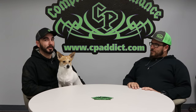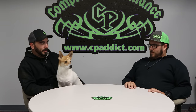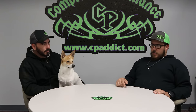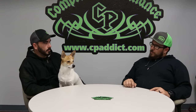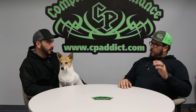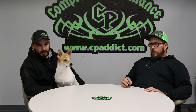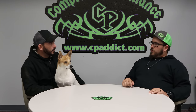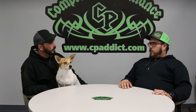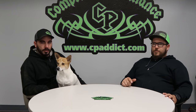In conclusion, Seth now has a 6.4 bumper on his truck. It's pretty straightforward — it beat the wonky jaw of the factory bumper. We had to trim the frame horns, and you've got to trim the plastic bumper pad that's on top of the bumper, but you don't have to trim the actual bumper. Batteries ran out in the camera so we couldn't go over it much at the end, but it's pretty straightforward. There's not a whole lot to it — just the trimming on the frame horns because it'll get in the way of the actual bumper. If you've got the hardware from the 08 bumper, it works — all the hardware just bolts right up. I didn't buy any hardware.